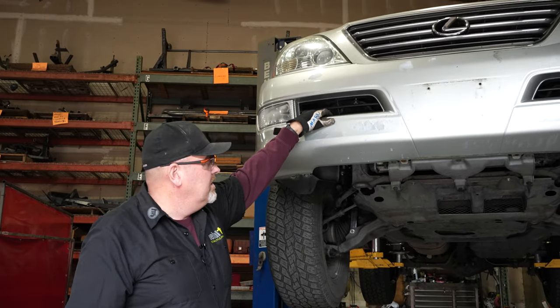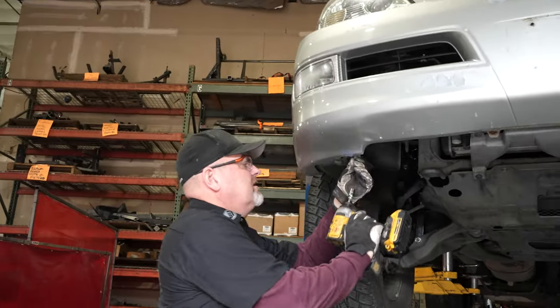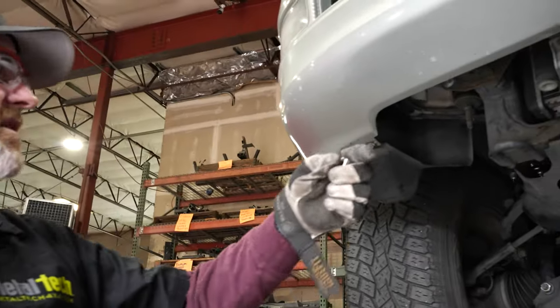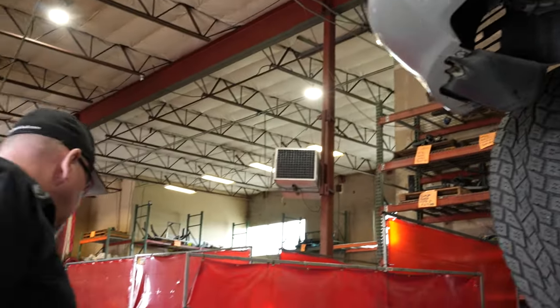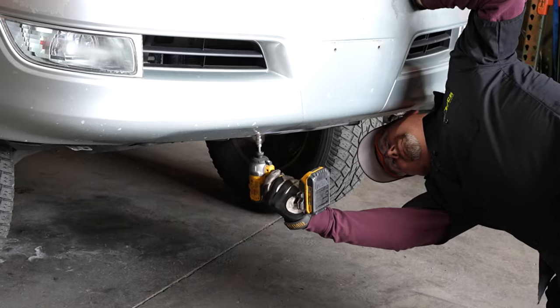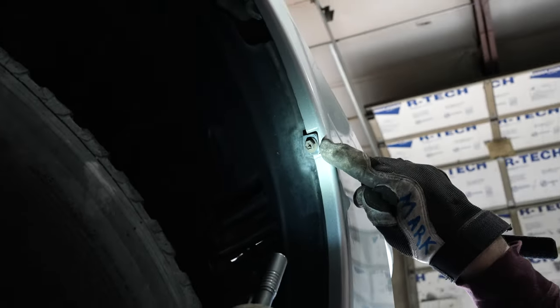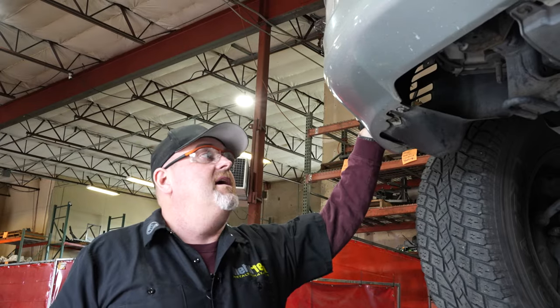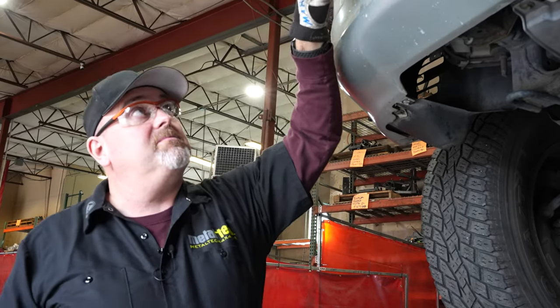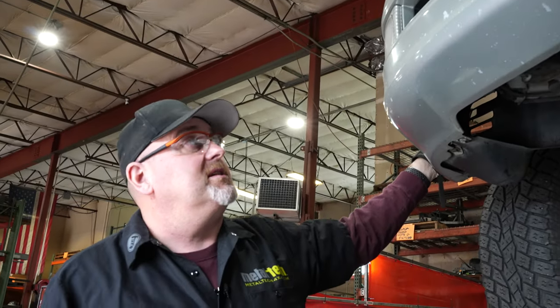Taking the factory skin off is pretty straightforward. There's a bunch of screws in the base that we're going to blow out and take out to help speed things up. We're going to pull all the fasteners from the plastic front bumper — a bunch across the bottom and one on each side in the wheel wells. Then from above, we'll release the few that are just behind the front grill, which will allow us to grab the plastic piece and take it off.